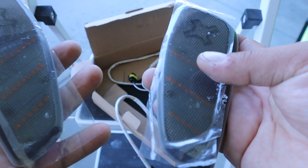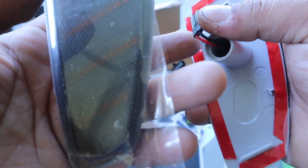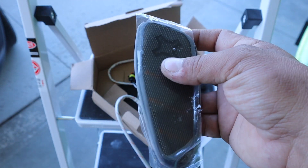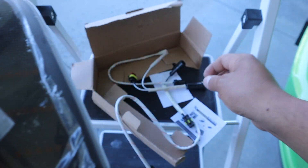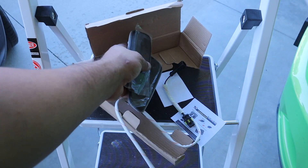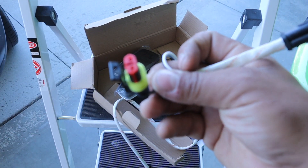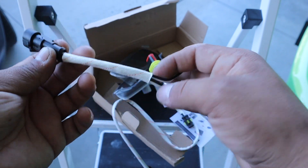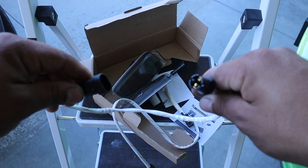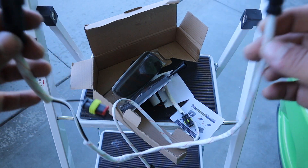For the simple install, you basically just unplug the existing light and plug the new one into the existing outlet — think of it as this being your entire bulb, works just like it originally does. With the wiring harness it works a little differently: it plugs into your DRL light bulb itself, and the other end goes to the connector that connects to the light bulb, making one complete circuit so it works as a turn signal. That's the best part, so I'm going to wire them this way.